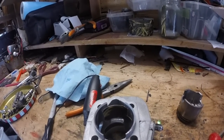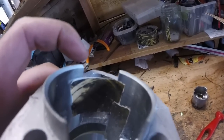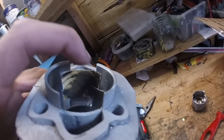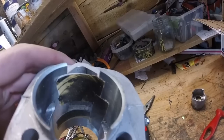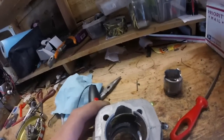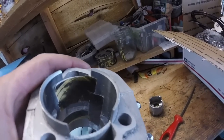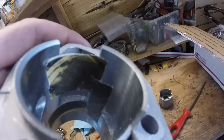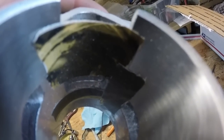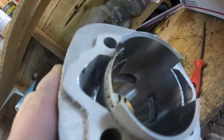So you lose about three or four millimeters. What I did is I took some heavy-duty duct tape to protect the chrome. You want to work on the exhaust side. The pins — the gaps for the piston rings — are both on the intake side, so everything you're going to be working on is on the exhaust side of the port. You want to get in there and widen it out to the stock width.